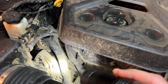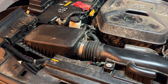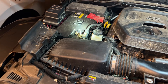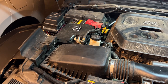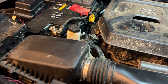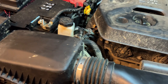This motor replaces the alternator. There is no alternator on this vehicle because there is no 12-volt charging. There is a 12-volt system, but the charging all comes from the IDCM in the back. It has what's called a DC-to-DC converter, and it drops the 408 volts down to 12 volts to charge the battery and run the 12-volt system. So this guy serves as starter, motor, generator, and alternator — it does all that kind of stuff.